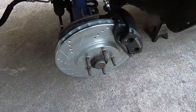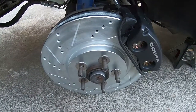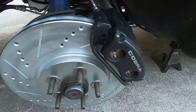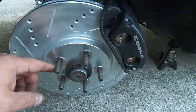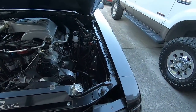Sorry I haven't been filming as much during the day — just ran into a lot of snags, one of those times where you just want to get it done. Now it's towards the end of the day. Here are the rotors and calipers installed. You'll probably notice why those washers are on there — my wheels just barely touch the calipers when fully mounted, so I'll either continue using washers or get a 1/16-inch wheel spacer. Calipers are on with stainless steel braid lines to the stock hard lines.